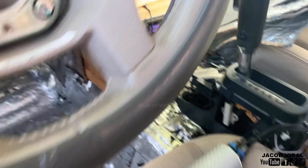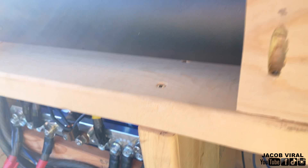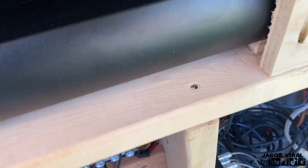I'm going to do the actual gain turning off-camera so I can be a little more safe — I like to have somebody up front when I do it. But that's how it works: bass knob all the way up, get it to the volume where you're comfortable, frequency set at 40 Hz, and the DD1 will pick up when it clips and shows distortion. That's good on that, and then the last step would be to get the multimeter and read the voltage output.